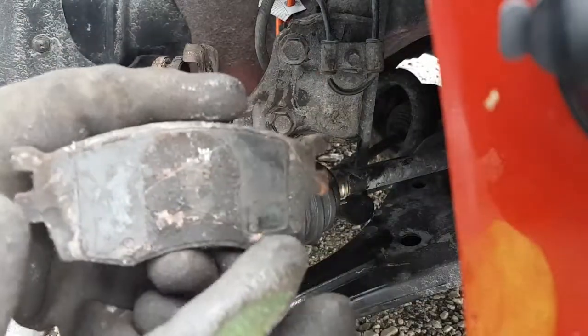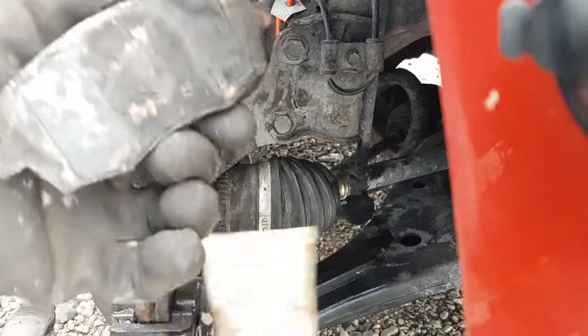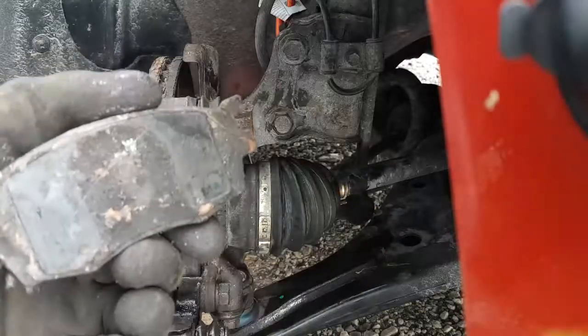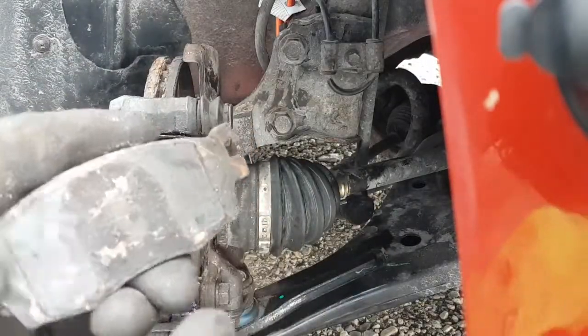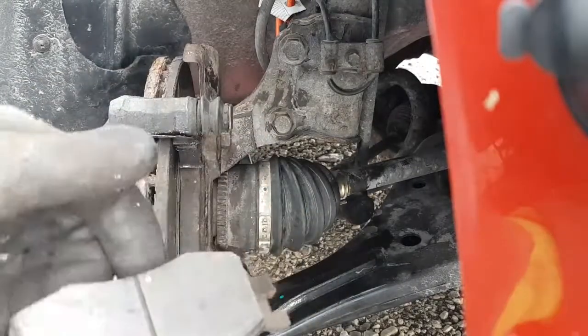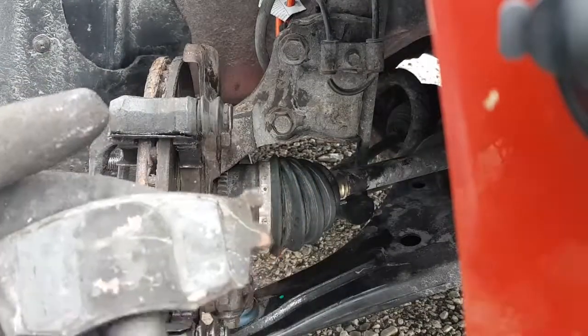And if you grease that, and the inside pad also in behind, use this stuff, because there's obviously rubber on the piston or on the caliper, so you don't want to get any petroleum-based grease there because it'll swell that boot up and it'll start leaking and seize up. But you keep these pads lubricated in behind here. This is the friction surface, so I'm talking about the other side where the caliper sits. It'll keep the noise down.